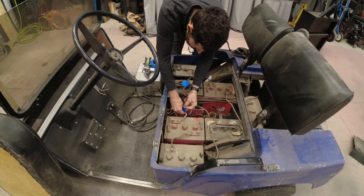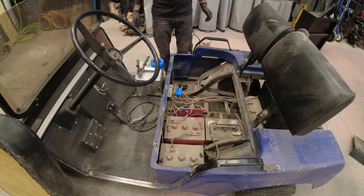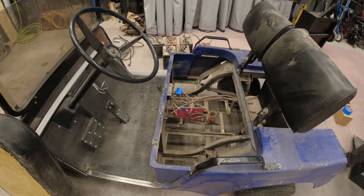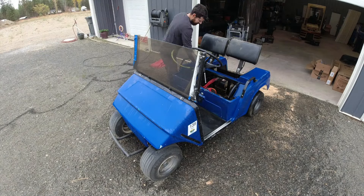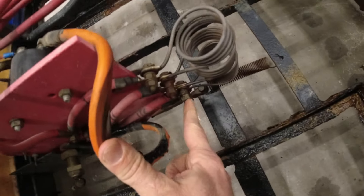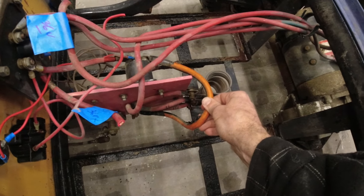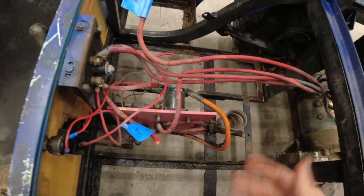Because these battery cables are all the same color, I went ahead and used some masking tape to label which ones went where before removing the batteries. Well, this thing ended up cleaning up rather nicely. The only cable with a ton of damage still on here is this one right here — it could have gotten too close to one of these bolts and shorted out, or just gotten too close to this resistor and gotten too hot. I should be able to just replace this one cable.